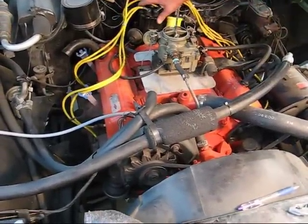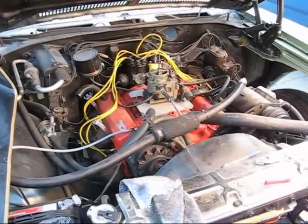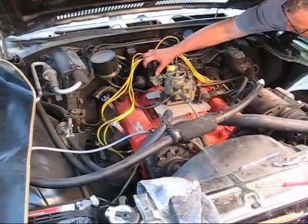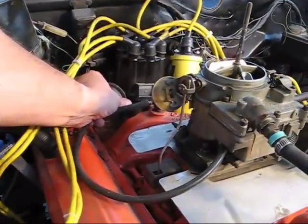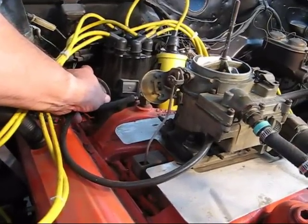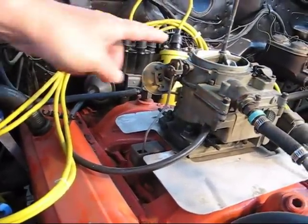Okay, it's advanced too much. Almost. This is how you change the timing — you advance it a little bit and you can hear the car running faster. If you go the other way it slows down because it's retarding the timing. We'll pick a spot where it seems to run faster and we'll turn the timing light on after it warms up. The choke is still not all the way open.